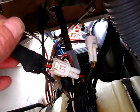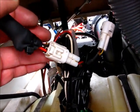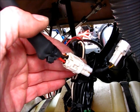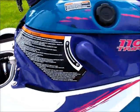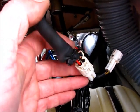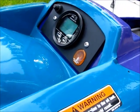The wiring — I struggled with it a little bit but I figured it out. There's a black, red, pink, and green wire coming out of this four-pin harness. I use black and red for power, and the pink wire comes off of your thermal switch — the thermocouple — right here. It's stuck inside the exhaust about two-thirds of the way back. That'll ground itself out and ground out in the CDI, making the engine run really boggy like it's only running on one cylinder so you can limp it home and not overheat it too bad. I wired in my dash light using the pink wire and the red wire — treating pink as ground and red as power — and it works pretty awesome.